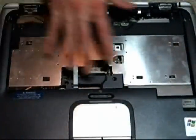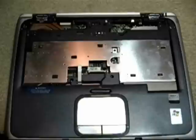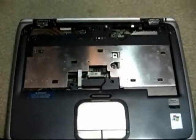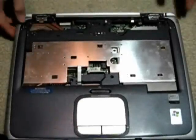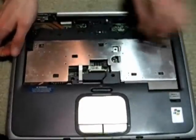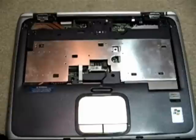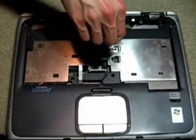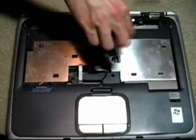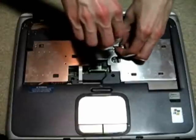Just got the base right here. All we have to do now is just pull this up. Looks like there's one more screw here — always watch for that. If you see any extra screws or anything, always make sure you don't forget those. Don't push it; look around. Look for screws if you feel it's stuck at a certain spot. Don't want to break your laptop.